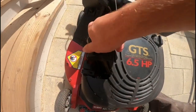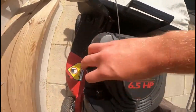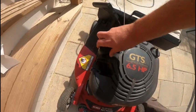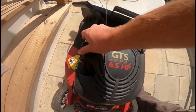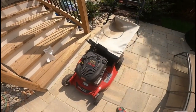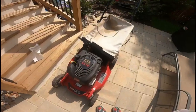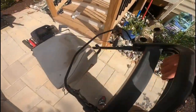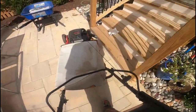Now check your gas — it's just a twist-off on most mowers, just like this. You've got your tank; check it. Mine's full because I like to keep it full until the off season. I'd recommend running non-ethanol gas, which I use as True Fuel, or just run it till it's empty. Preferably you want your gas empty out of it when it's out of season and you're not using your mower.